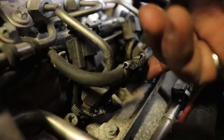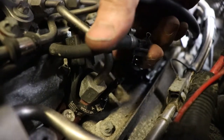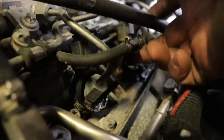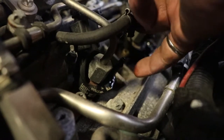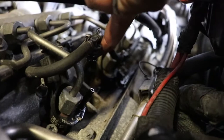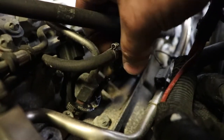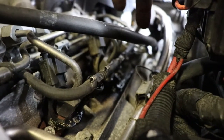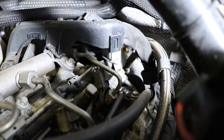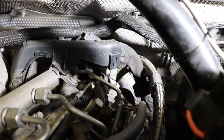I got the first return hose off. There's a wider ring — you have to pull up on it to disengage it, putting a wrench around it and gently lifting up, and then it separates from the fuel injector. You don't want to break these off because fuel injectors are very expensive. The important point is you have to spin these until they're loose, then lift them up. I'll also need an E10 socket to take the electrical wire cabling off the final injector area.